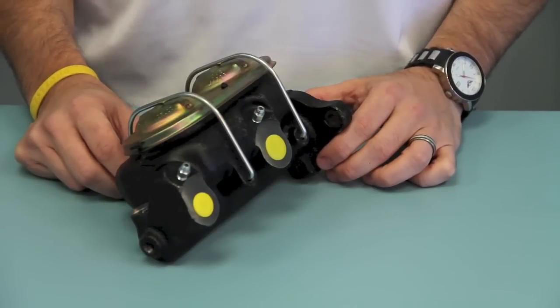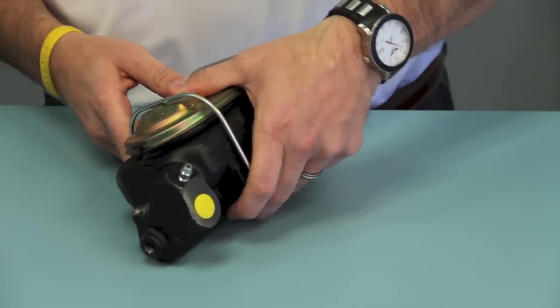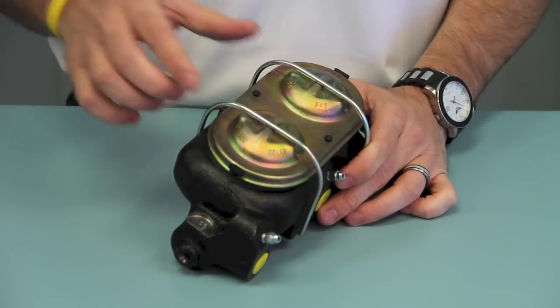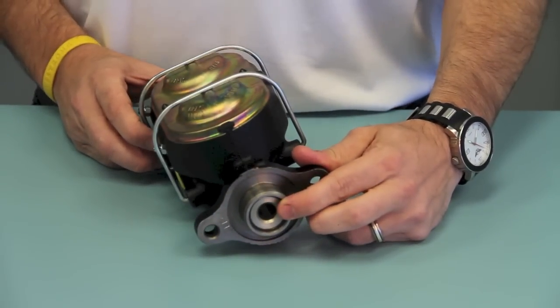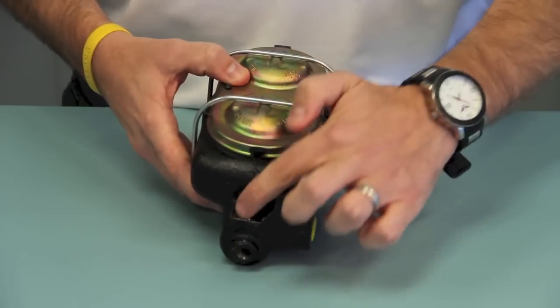This example is for a 1968-1972 power brake car. It's got the original style cap, it's got J-1703 stamped in it, original bales, and cap gasket comes with it. This one has an inch and an eighth bore, dual bleeders, also stamped like the original PG.